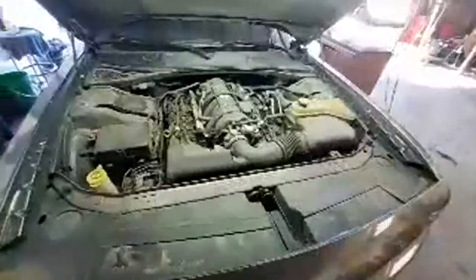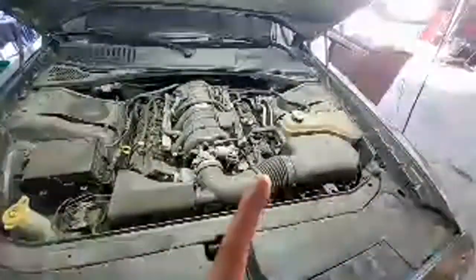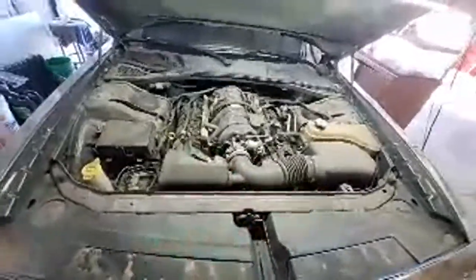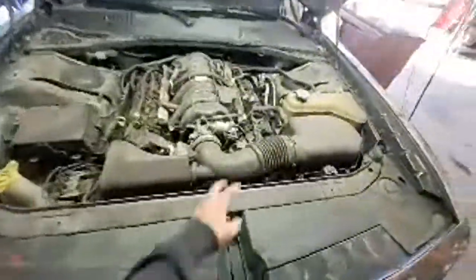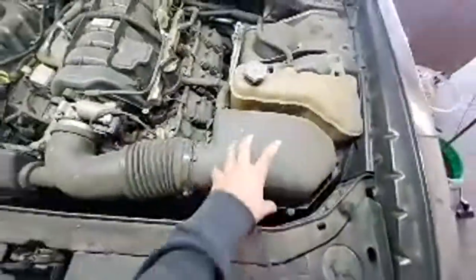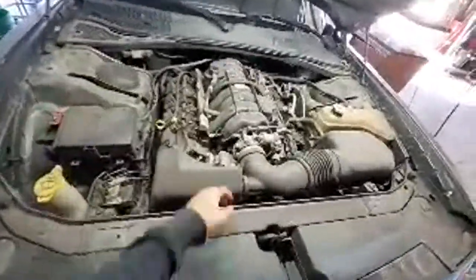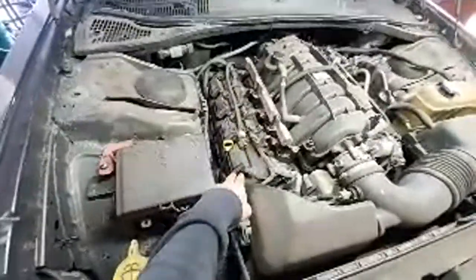I'm going to show you how I get it done. I have many videos on this one but this is going to be the full thing. You guys can already tell the video quality isn't great — it's my cell phone because I'm doing this live. First thing I'm going to do is remove the cover, then we're going to remove the air cleaner — 8 millimeters. Remove this one, remove from here, start removing everything from your way. Disconnect everything in your way. On this one we have coils, so we're going to use 10 millimeters.